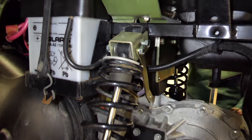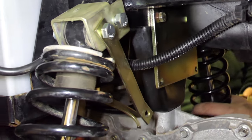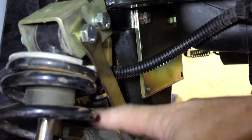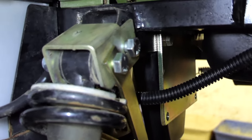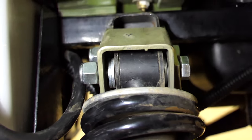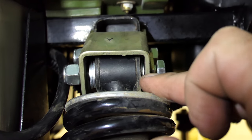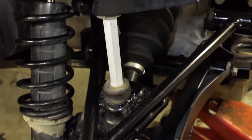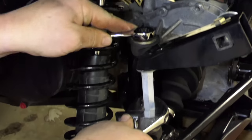So we've got the other couple of bolts in here for the top part of the shock. You actually have this bracket that comes down to go to the bracket here — make sure you put that in, it goes to the back side of that plate. Then put a bolt in there for that. On the top of your shock you're going to put one washer. It didn't say in the instructions, but we put the two washers to the front side of the shock and the single washer to the back side. Then tighten it up. On the other side we still have to switch out that torsion spacer, and then we're pretty close to being done with the back.